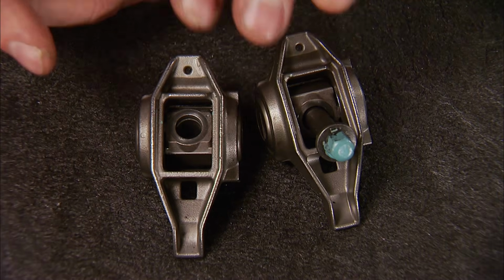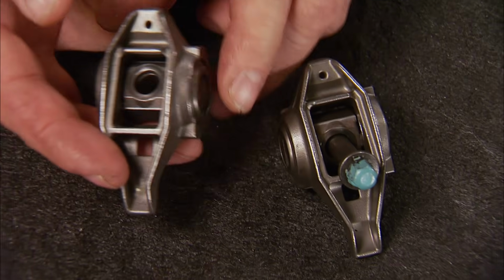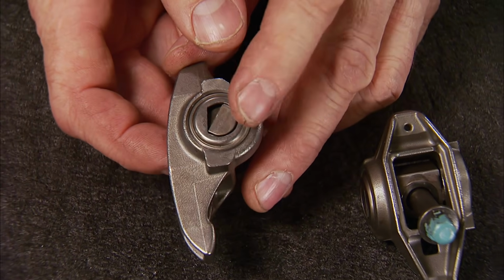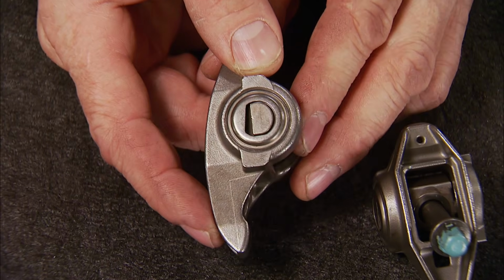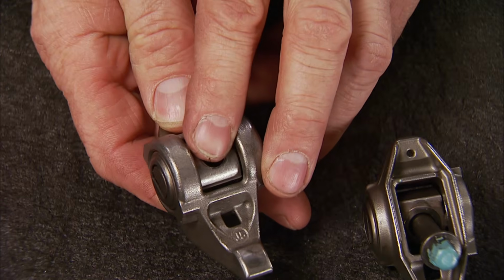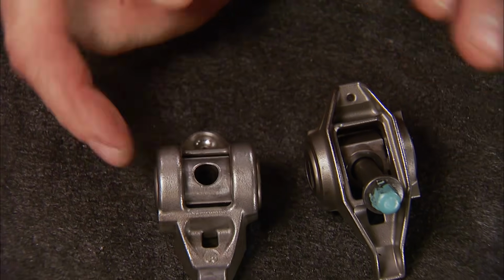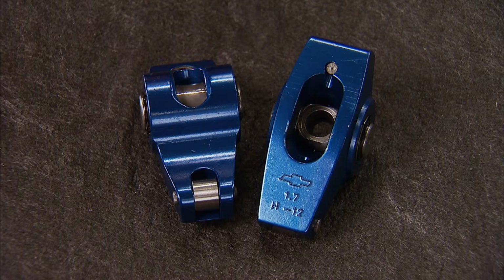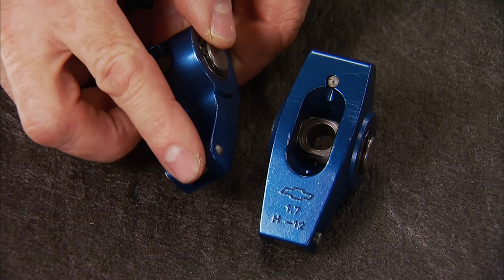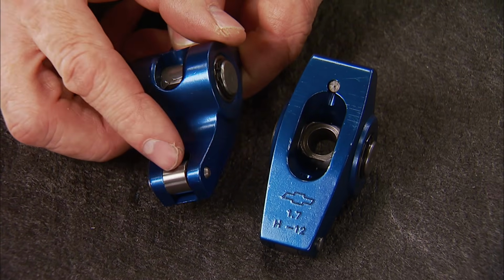An upgrade to that old technology is a roller trunnion rocker arm. To decrease friction and improve valve train geometry, the rocker body has a shaft in it that rides on some needle bearings. OEMs have implemented them in many applications, seeing the value of increased durability and valve train accuracy. The aftermarket has taken them one step further by incorporating a needle bearing roller that rides on the valve tip as well, decreasing friction even more.